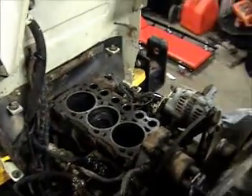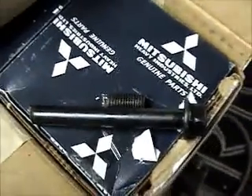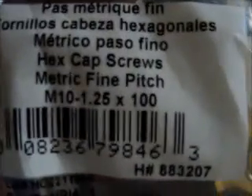I'll show you what I encountered. I got a bag here with my nifty assistant. I took the head off and this is what I found — this little head bolt had twisted off. Now this is not a proper fix and I do not advise anybody to ever do this, but I'm going to attempt it because these outer head bolts do not get very much torque on them. So I picked up some bolts from Lowe's.